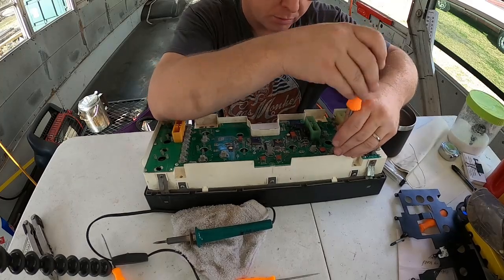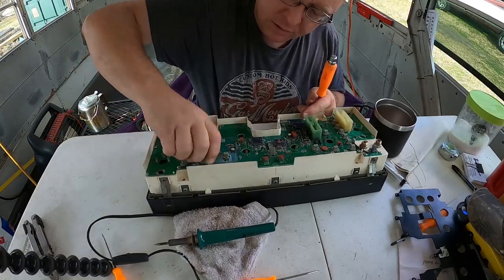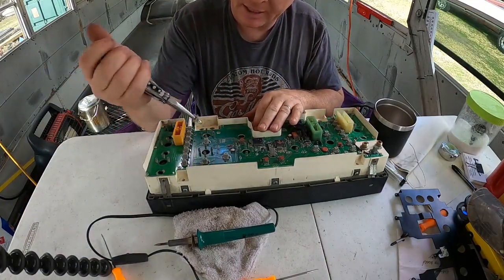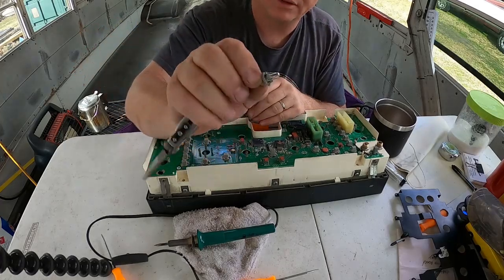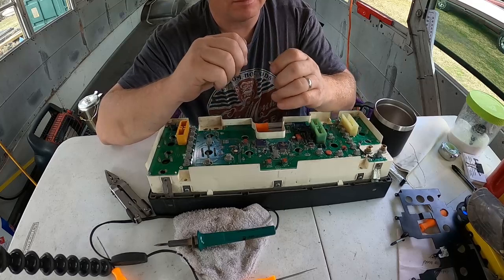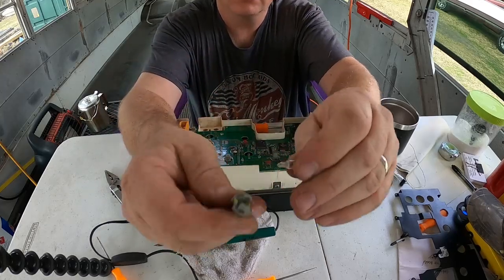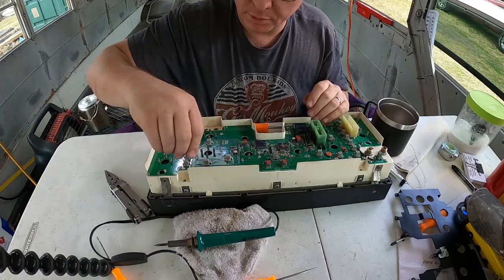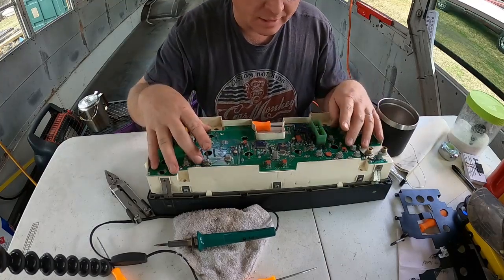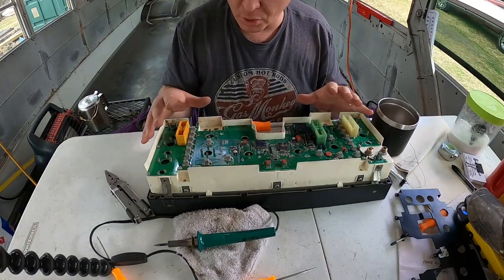This is where you would change your bulbs for your left turn, your right turn. Like, here's your left turn bulb, your indicator bulb. I can't turn it. Let's see. Basically, you can grab a hold of these typically by hand, and you just twist it a quarter turn left, and that's got your light bulb in it. And yeah, there, you just pull that light bulb out, and it plugs into there. So just like that right there. That's how you replace them, if you didn't know. So there you go. So yeah, your dash lights and everything inside here, that's what these little gray things are. If you wanna replace all of the bulbs, you're gonna need